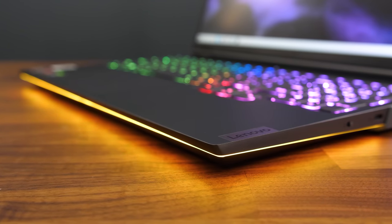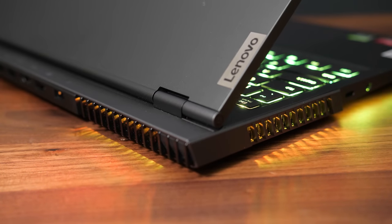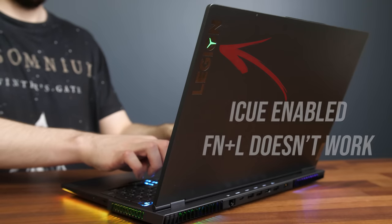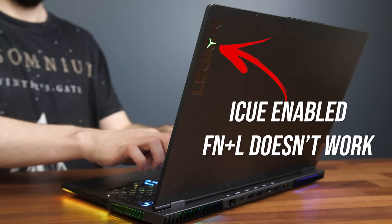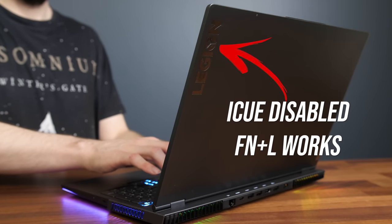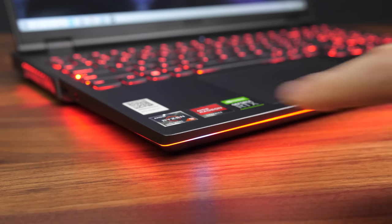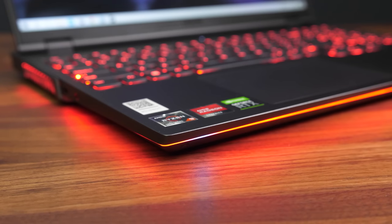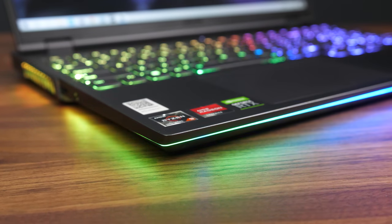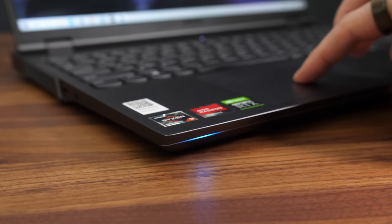There's also a light bar that runs along some of the left, right and front sides, as well as lighting in all four air vents and lighting in the letter O on the lid, all of which can be customized through iCue. You can turn off the lid light with function plus L, but again only if you're using the default built-in effect rather than iCue. With a custom effect this does not work currently. One of the LEDs in my light bar appears to be stuck regardless of what colors I set — it's only obvious if it's in contrast to the other colors, but if I set all lights to red or black it becomes apparent.